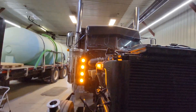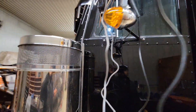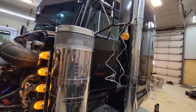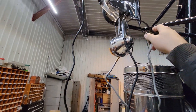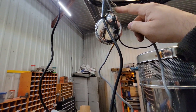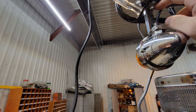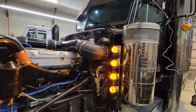The reason why I have to add that ground wire: the original plan for these lollipop lights was to just run them as a marker light and not as a turn signal. But I got thinking — if they're gonna be hanging out there they might as well work as a turn signal. So those are the two wires I ran. I should have run a three-wire shielded cable through the mirror bracket, but I didn't. So I hooked them up to the two power functions on the light and then for the ground, rather than grinding down the powder coat to make it work, I'm running a separate jumper.